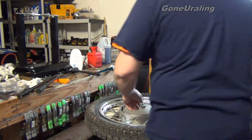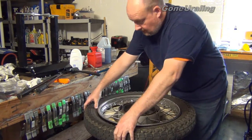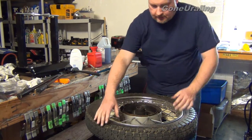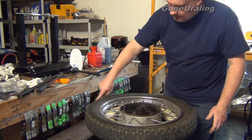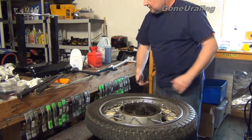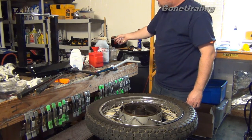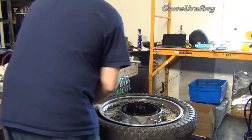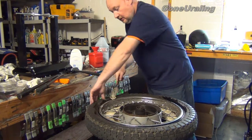Here's where people get confused — they think they should go ahead and break the top bead, but you can't really do that. What you've got to do now that the bottom bead is broke: the top bead is not. If you try to use the bead breaker again you're just squeezing the tire up. So what you do is go ahead and demount this side of the tire, then use the bead breaker again and pop the rest of the bead off. I'm using my snot lube — it's got the consistency of snot. I just run this all the way around it to make it a little easier.